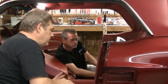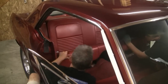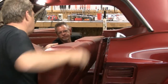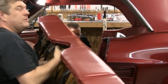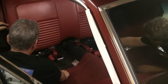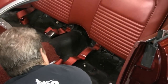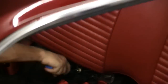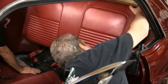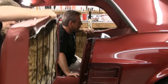Now when you're taking these back seats out on these Fords, you want to put pressure up and basically bang it out, then pick it up and pull out. You'll be able to see the little knob sticking up — you've got the tabs in there. Now the base we're not going to do anything with; it's the back that we're looking at. We got two bolts on the bottom — basically this holds it in position — and there's two clips up at the top. There we go. We're going to go set this on the table and see what we've got.